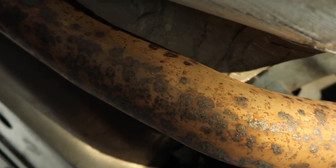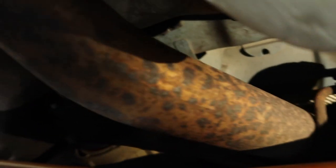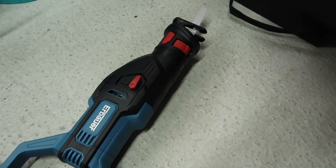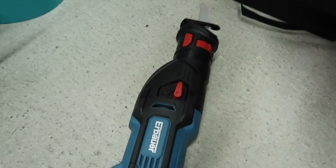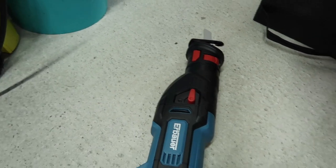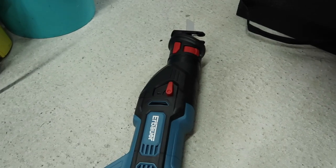You don't want to cut through a bend because if you ever want to put the standard exhaust back on, it would be a nightmare to get a sleeve on a bend. You want to cut on a flat section — typically people cut about halfway between the hanger and that bend. I'll see if I can get my saw in there. I'll be using a reciprocating saw, often known as a Sawzall — a pretty beefy one. We have to be careful cutting through metal, so for safety reasons I am going to wear eye protection.